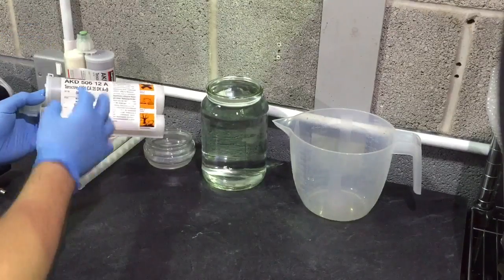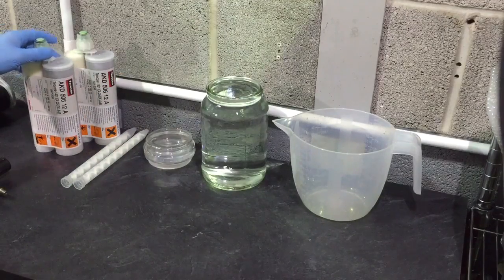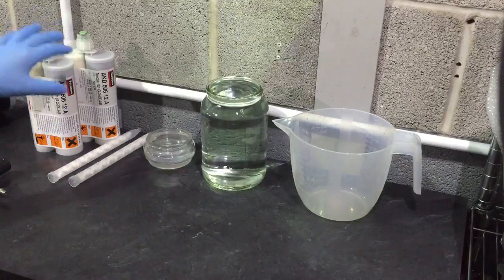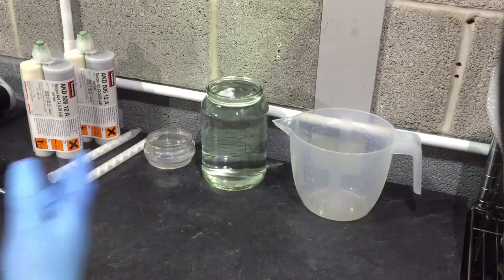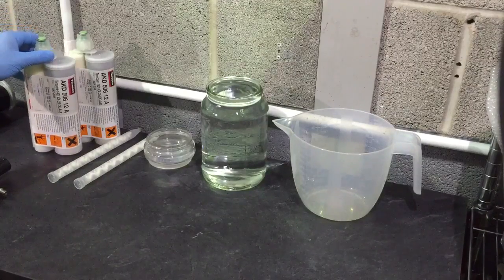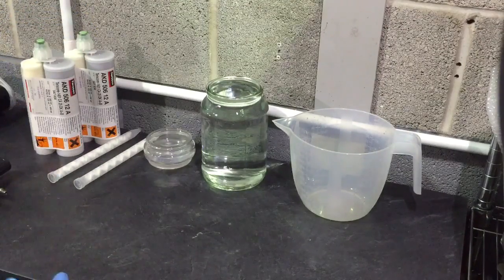In the cases or cassettes, once two are mixed together, you get give or take 400 millilitres — you always lose a bit in your mixing tubes. BMW suggests that two of these kits go into the left-hand side, left-hand rear. We do left and right, so we'd use four, but for this purpose we're going by the BMW repair procedures, which say use two. So in total, they're suggesting 800 millilitres get injected into the cavity of the rear axle carrier panel surrounding the left rear subframe mount.